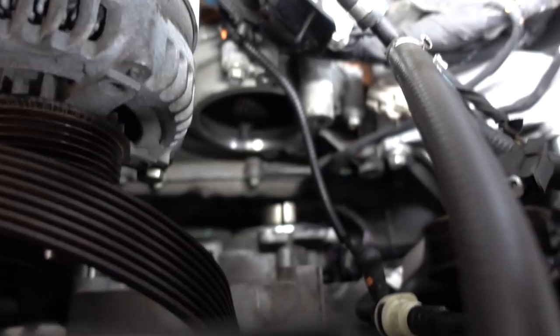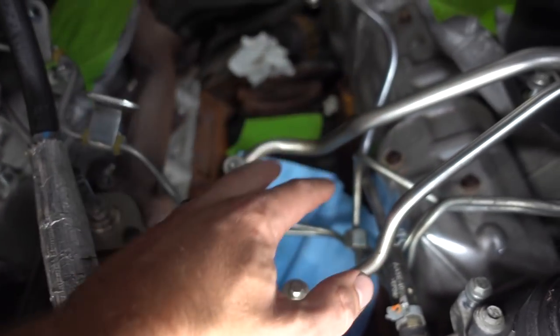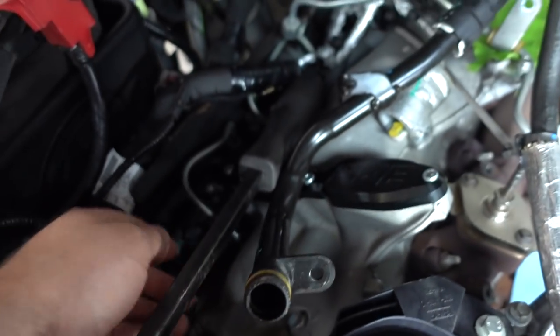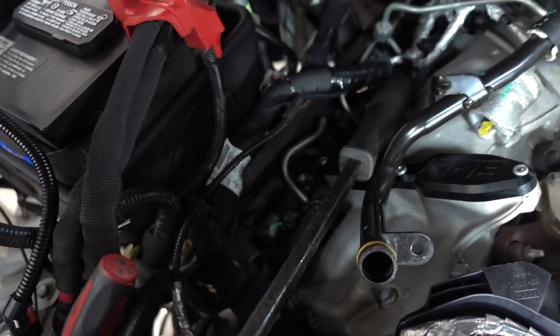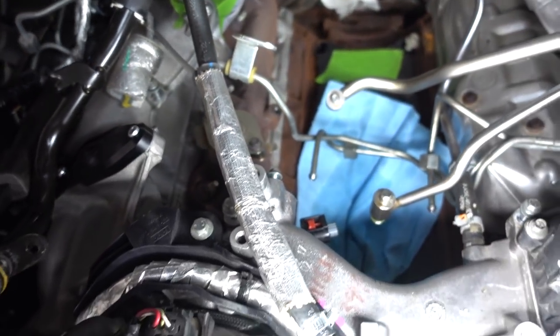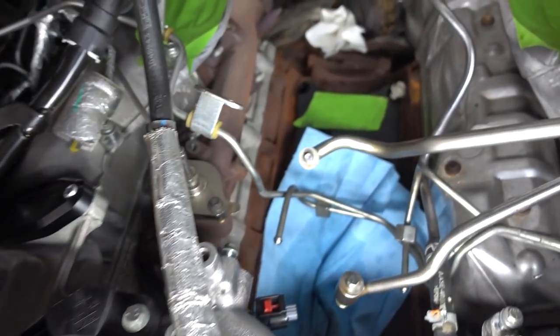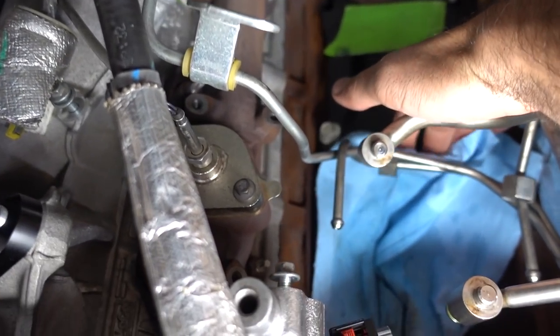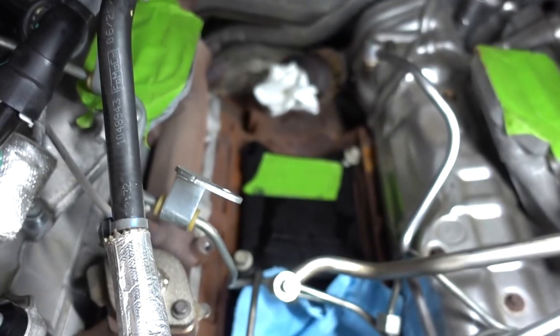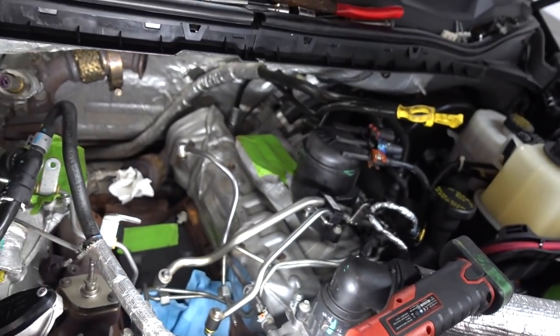The vacuum pump is hanging out right there. We have the bolt and nut off and I just popped the CP4 loose. I took off all of the fuel line mounting brackets so the fuel lines are loose and hanging out. I popped off the crossover fuel line that goes over to the passenger side fuel rail, folded it back so I didn't bend any lines. With all the brackets loose you have enough play to slide them back and get the pump out. Turbo is out - I put the SPE pedestal cover on so nothing would go down into the engine.